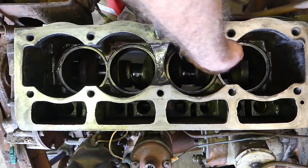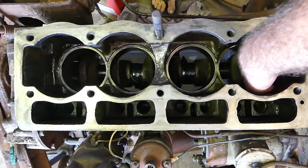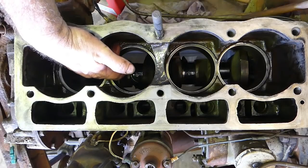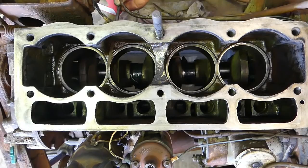Before I put the liners in I'm going to make sure there's no burrs or anything down the bottom there. Now another thing I haven't mentioned — there's a little hole through the side here for the drain tap. I'll use the dipstick to show you — it comes from the side in through there. Just make sure that's clean; it's an ideal opportunity now to free up your tap without pushing junk where you don't want it.